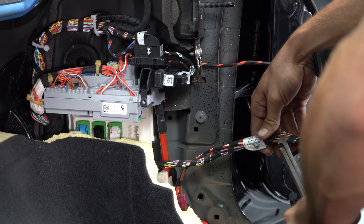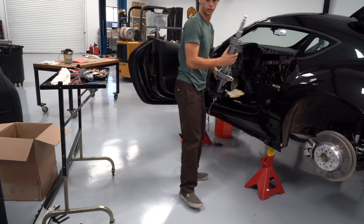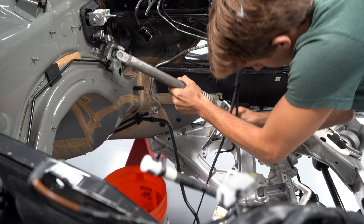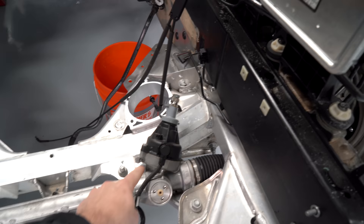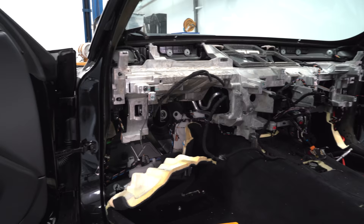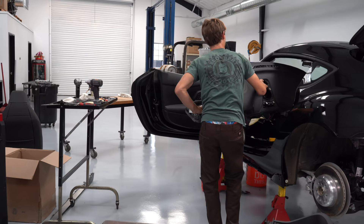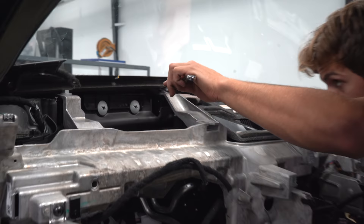A lot of the time we're actually just taking pliers or screwdrivers and prying them off because we know we're not going to reuse them. I know it's a little sad to see all these brand new components being cut and ruined and thrown away, but at the end of the day we just build competition cars. For the sake of efficiency, we just need to get these things out of there. We won't use the factory steering wheel — we'll set that aside — but we may use the steering column. The car uses an electric rack and pinion, so there's no hydraulic; all the assist comes from electric power. We will reuse the dash, but we're not going to use the big aluminum brace underneath it, and we're not going to install the heating and air conditioning back into the car. In these competition cars, we just want to keep what is going to make the car faster and more competitive, and sometimes the driver will have to deal with a little bit hotter cabin for the sake of performance.